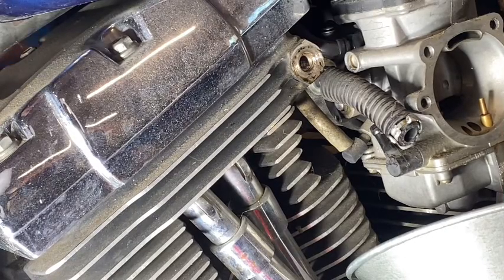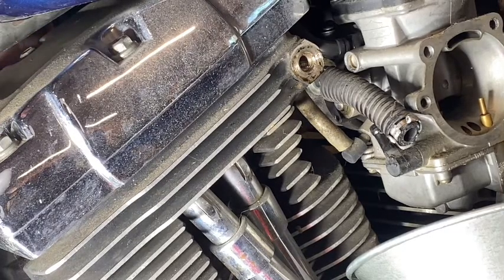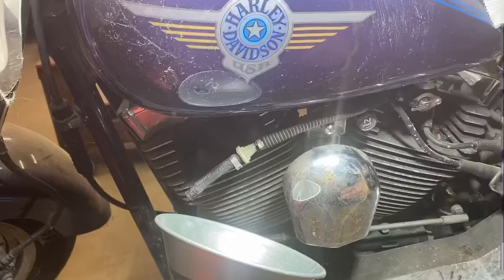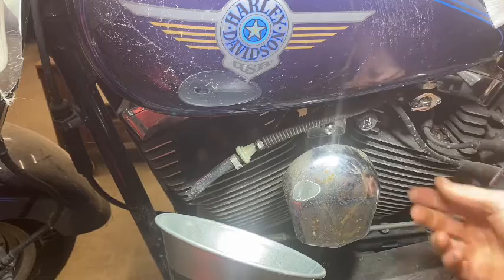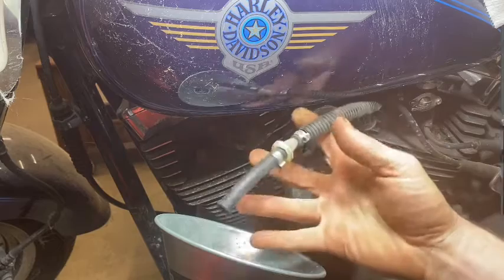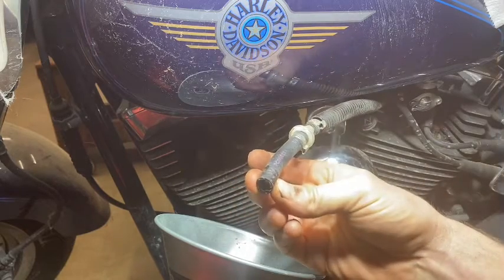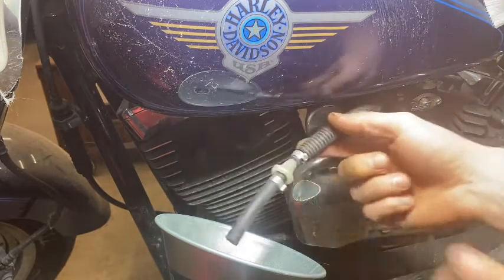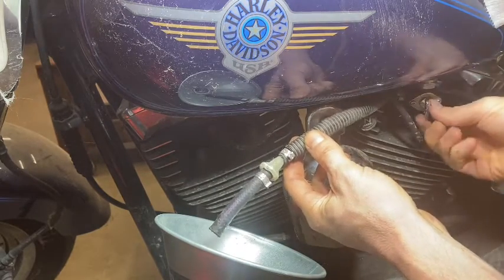I went around and turned off the fuel, so now let's turn on the fuel on the petcock and see what happens. We're getting no flow at all. I have a stinking suspicion that might be why this thing wasn't running too good. I've seen something else that looks a little fishy underneath the fuel tank so let me go ahead and release this whole fuel line and take a look at it.